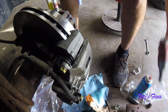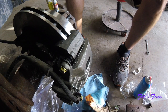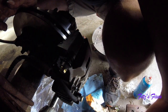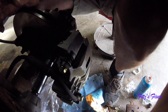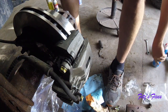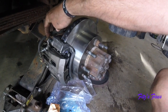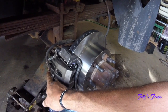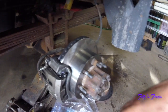Now the impact, I will tighten 18mm again. I will tighten the caliper bracket. And that's it. So I'm gonna go back on the back there and just torque those down. I don't ever torque these guys down. If you tighten them too much, you're just gonna break them anyway. So just make them nice and snug. This one, I don't know. I don't even think there's a torque rating for it because there's those crush washers behind it.